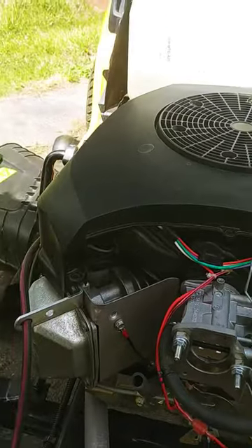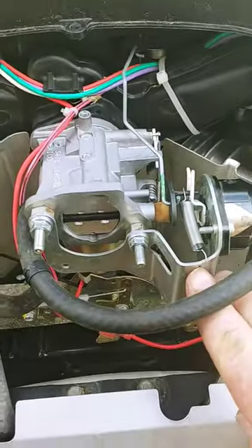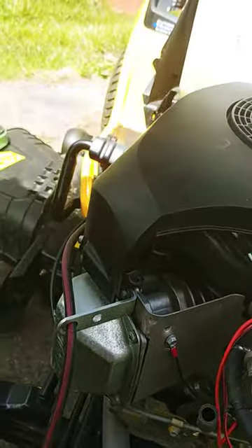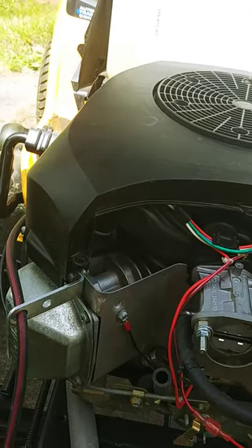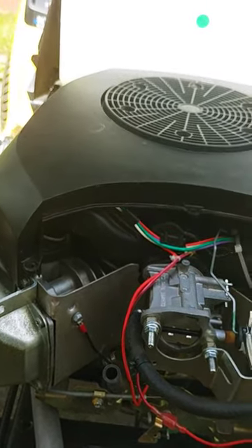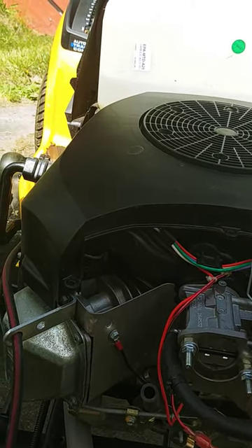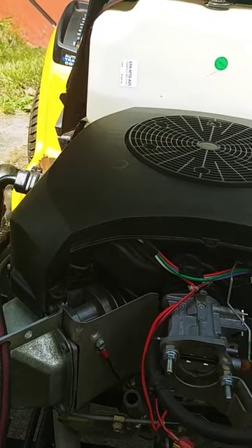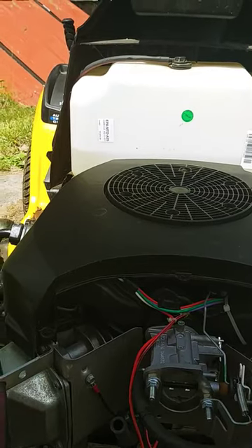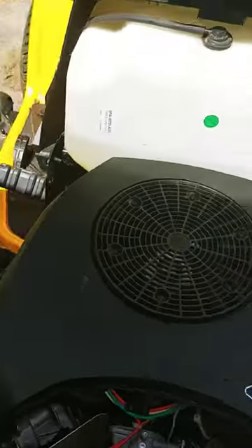So what I did is I drilled a small hole here and hooked a small spring to it. What this is doing is every time it goes to start, the butterfly is just flapping around, so it's not shutting and letting the gas get into the carburetor the way it's supposed to. This extra spring holds the smart choke back and holds the butterfly closed long enough to where it gets the thermostat to work in and start doing its job. I'll give you a little demonstration.